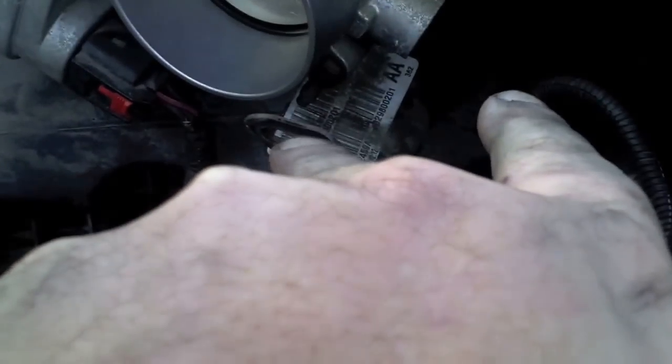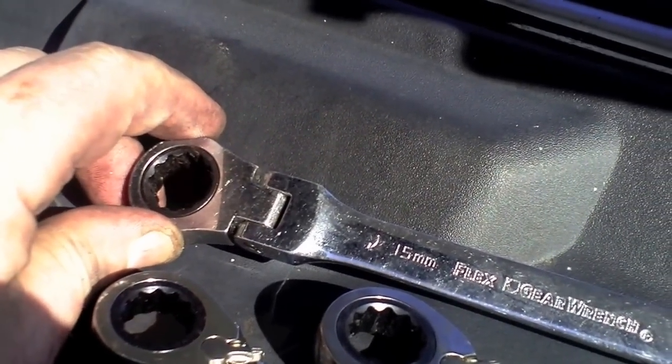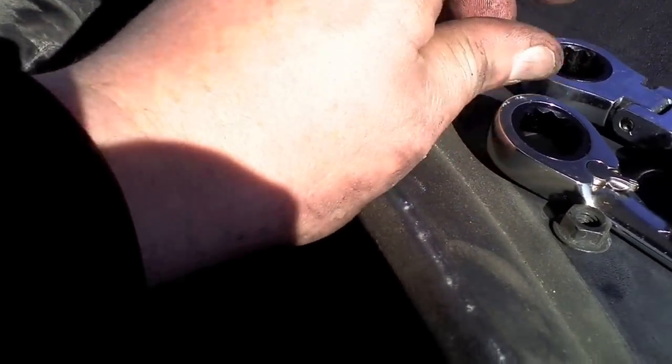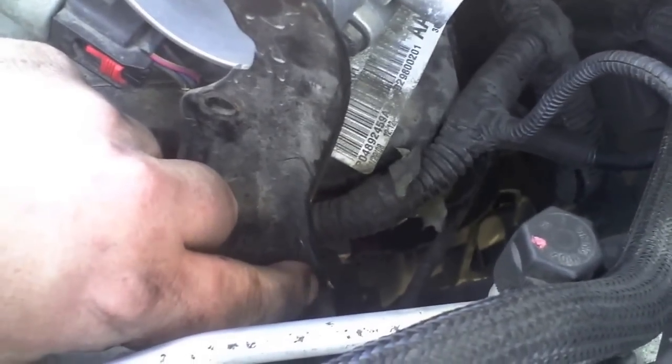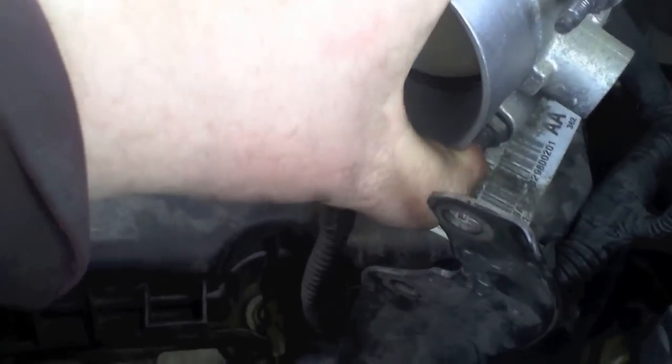I got this bracket loose now. There were actually two bolts - one right there and one over here. This bracket kind of expands - there's one bolt on each side and they're both 15 millimeter. I ended up using my flex head GearWrench. The angle was just weird with the bracket because these parts stick back, so you can't get a straight wrench in there.